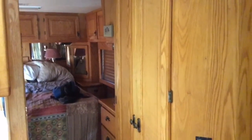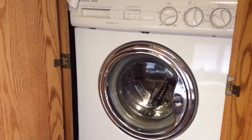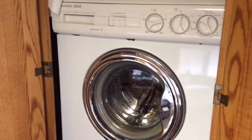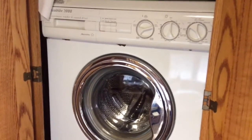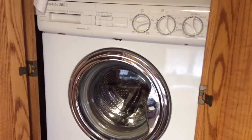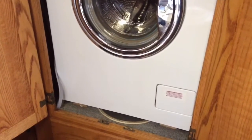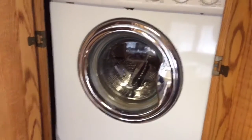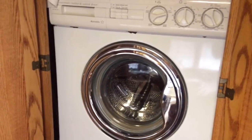There's a really nice big upright cabinet — that's where our washer and dryer is. It works very well. One thing about that: just keep the vent cleaned out. It has a very sharp right angle in it that isn't the easiest to get at, but if you keep it clean it does a great job drying clothes. After just a couple of loads it gets lint in there, so you've got to clean it out. I'll show my method in a later video. That's also the wet lint drain on the right side — keep that clean too. When you know the little quirks, these things work very well.